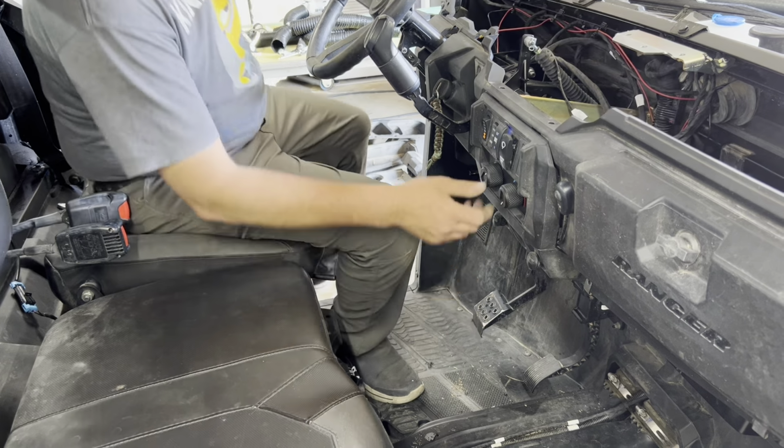Mostly coolant, so that's good. I think we're done bleeding this thing. I think we just top it off and bring it on up the temperature. Halfway between the max and the top of the tank. Put the cap on. Put the overflow bottle cap on just so we don't lose anything. Take a mental note of where the level is on the overflow bottle.